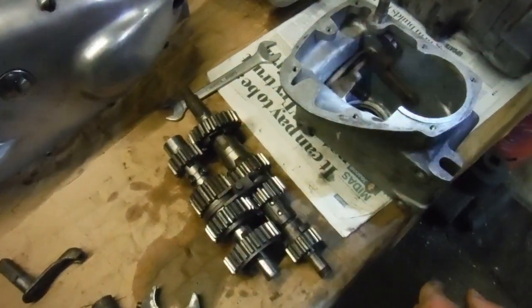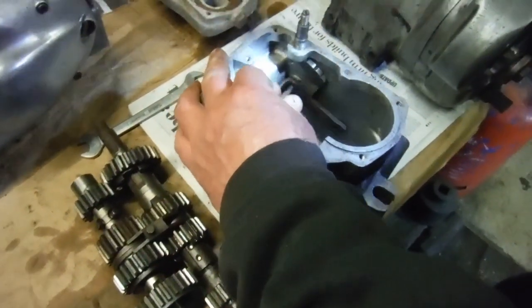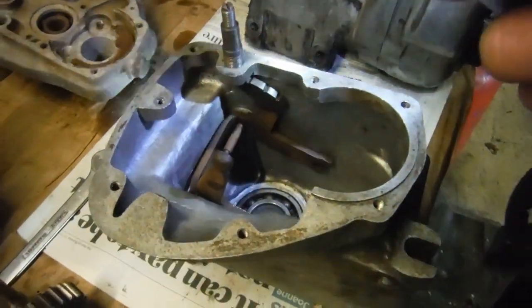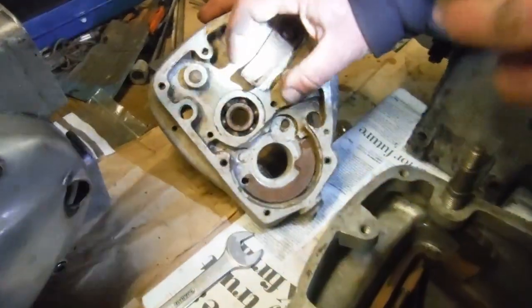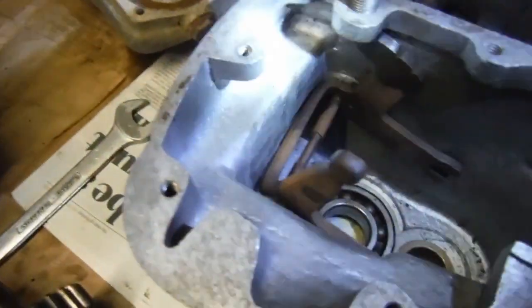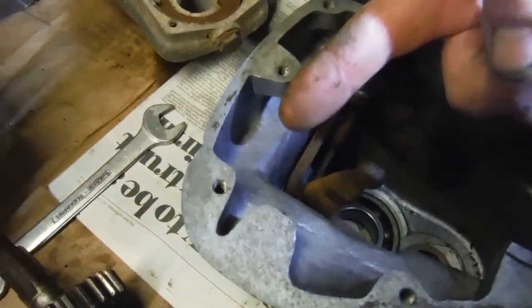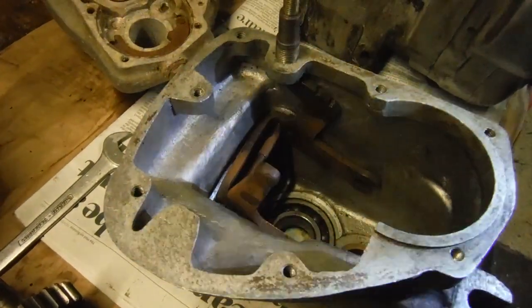Now what happens, in order to move this inside the gearbox, the inner casing on the inside, here's one from an earlier machine, but you can see we've got this here. Now that, where I've got my finger, represents the bit that engages with this. When that moves in an arc, it moves this through the various clicks and into the various gears and neutral.